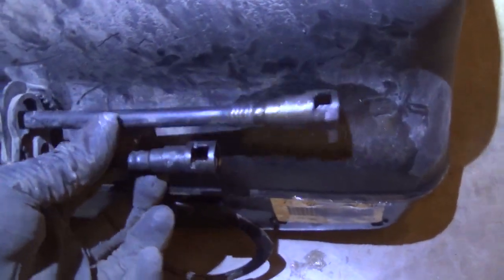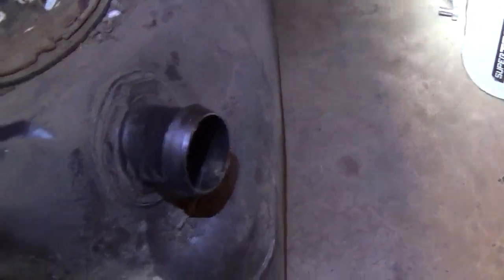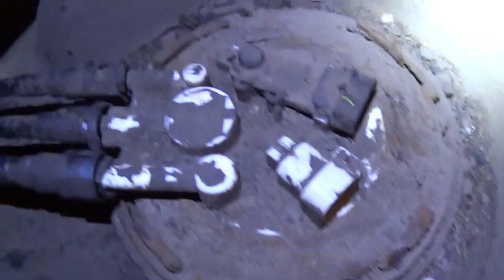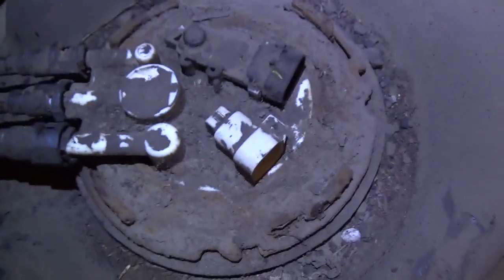After a little battle we got the tank extracted. Easiest way to do that is disconnect your high pressure and return lines, your evap line, and then once you get it lowered a little bit, disconnect the collar for the fill hose. It should slide right out. We're going to clean it up, stuff a rag in here so we don't get any dirt inside the tank, and then deal with this rusty mess. There's a lock ring on here that we need to use a little air hammer action to pop off.